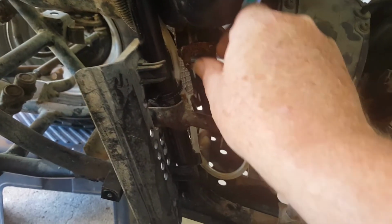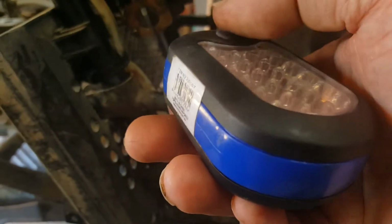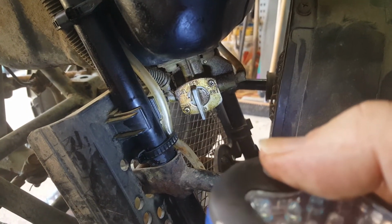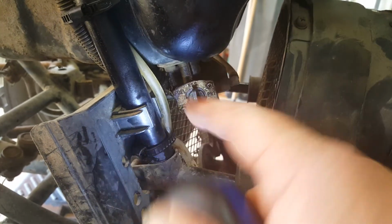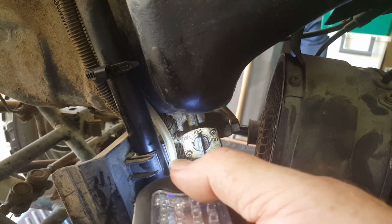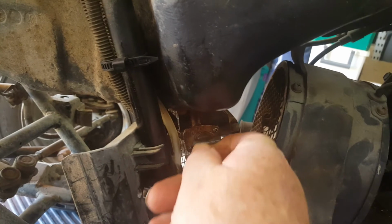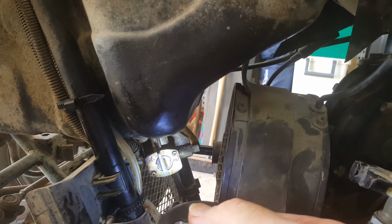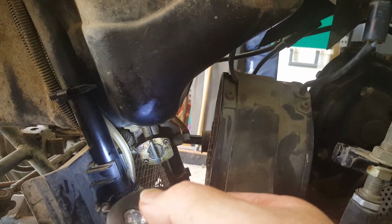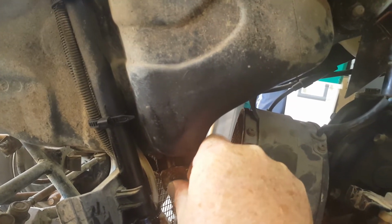Having a think about the startup of the engine, the first problem in looking back at the video was that the starter stalled almost immediately, and I'm thinking that that's because petrol has run down into the cylinder and it hydraulically locked on the first two attempts to start, and then it cleared that fuel, and then it would have been terribly flooded. But the amount of fuel that I poured down that funnel to get the bike going, it was just running away somewhere, and I suspect the needle and seat in the float is open and it's just letting the petrol pour straight through the float, and it's overflowing into the carburetor and then flowing through into the cylinder.